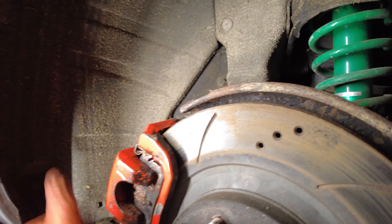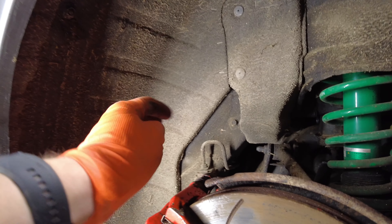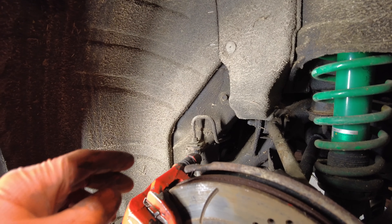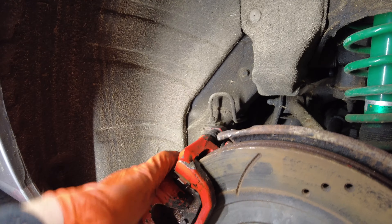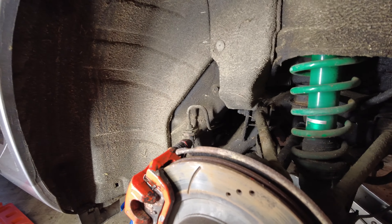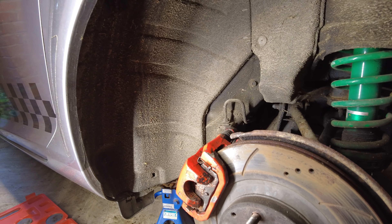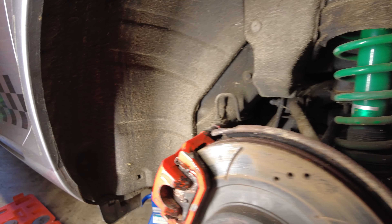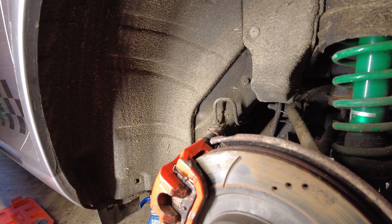This side is all bolted back up. The pins were fine — I gave them a quick cleanup but they were okay. Something to note: I was looking last night and it's about ten quid a corner if you wanted to do this job properly and just put new pins and hardware on the brake calipers. If I have to take them off again I will do, but at the moment hopefully this is all going to work.